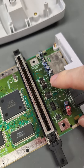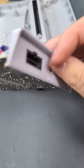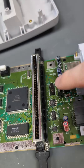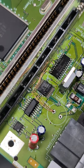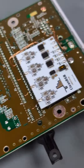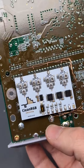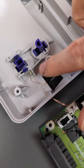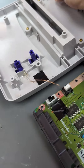So the last step is to add RGB. The Juniors still output RGB on the encoder chip, but it just never makes it to the AV port on the back. So all we have to do is install a clean RGB and wire in the pins from the input here and wire them to the AV port. The wires are tapped off and passed through an unused capacitor hole for neatness, and on the back I've stuck the clean RGB board and wired it into the AV port. Before reassembly, I've added a double strain relief on both ends — so if anyone opens it and tugs, they'll tug the wire, not the solder joints.